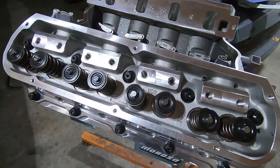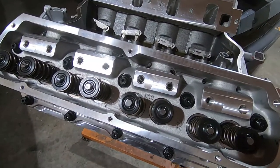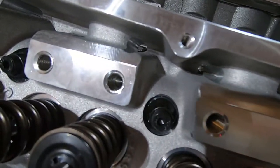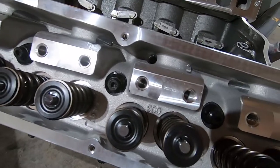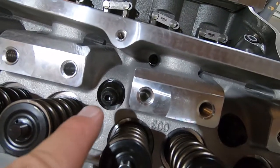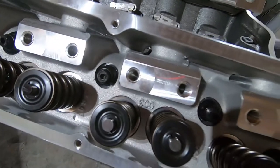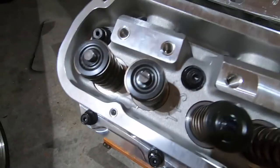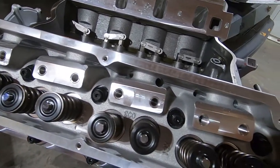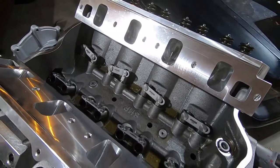It definitely pays to have those spacers under the lower studs — now all the studs are perfectly level with each other and level with the top of the nut. This head stud kit — I've been waiting on these things for like six months. I decided to upgrade to 12-point half-inch 20-thread ARP nuts, bought separately. On an inline head it's just hard to get a three-quarter socket without hitting the valve springs, so the 12-point gives you more room for the socket. They do sell these head stud kits with 12-point nuts already on them, but this one came with six-point — those will just be spares. Thanks for sticking around — we'll see you on the next one.